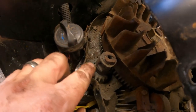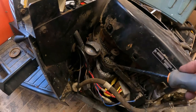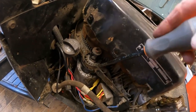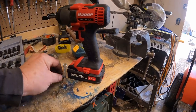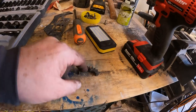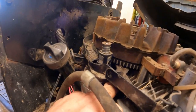We got it off — it's basically just held on by a hose over there. But look at what we found — we got a couple of pieces here, which means we're not just going to oil that thing up and hope it works. No amount of oil is going to make that work. We're going to have to order a new starter. There's some of our teeth — that's aluminum or plastic, we're going to go with plastic. We got the rest of the pieces from the old gear out. This is the dumbest setup I've ever seen a manufacturer do — obviously there was no engineer involved.